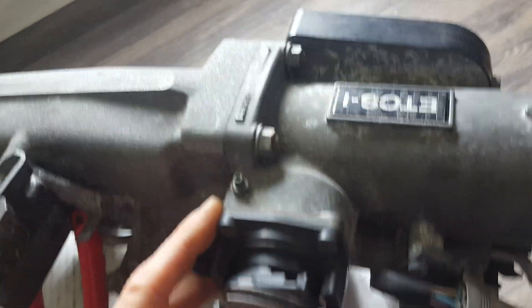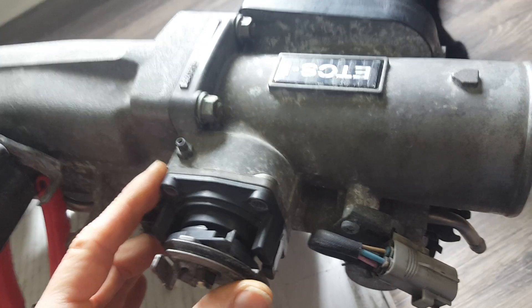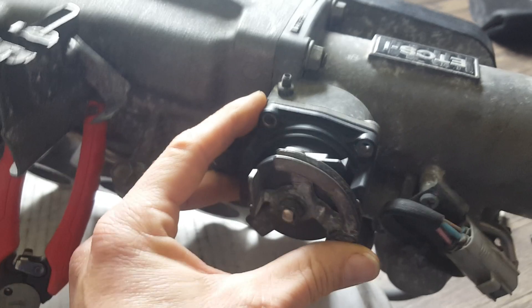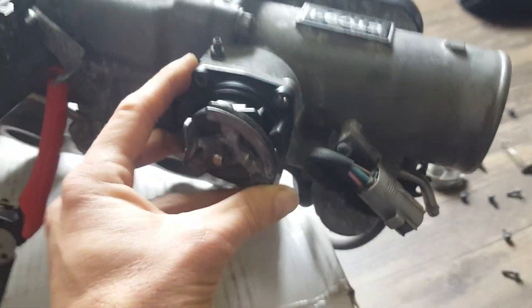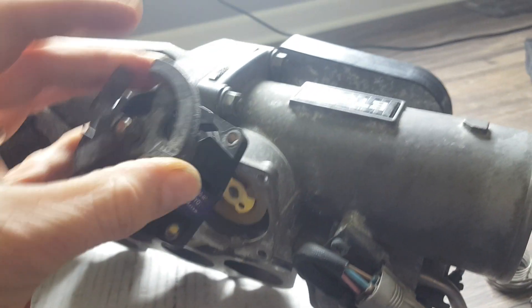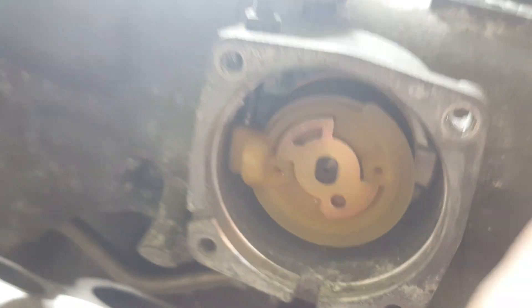The issue with the bypass on this particular type of throttle is that the motor controls the actual throttle. The blade doesn't seem to move for the entire first three quarters of throttle movement, and that's largely due to this cam right here — it starts way up at the top and travels that much before it even gets to the blade. Once that gets pushed you can hear a bunch of crap going on. With full control of it I can get that blade to open.